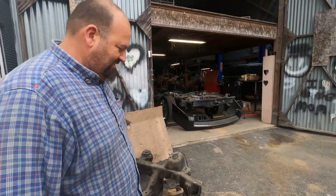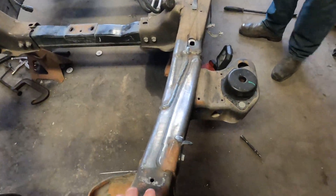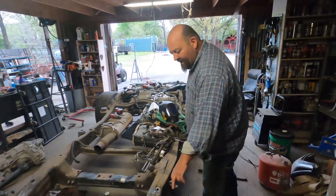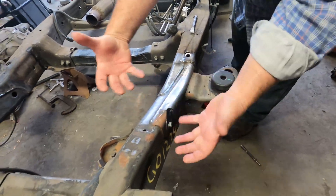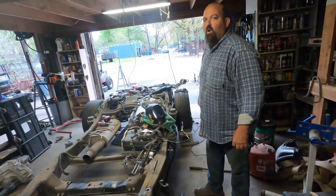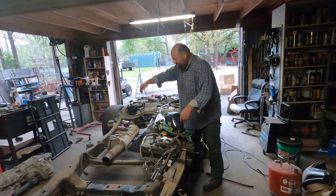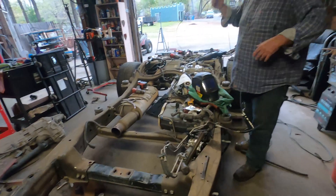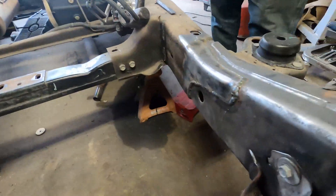So let's go see how frames are assembled and how you fix them. You can see the front section is already on. Before we go into how to do it, we'll explain how it's put together and why you can do it. The frame is actually built in two separate sections. The rails are called hydroformed because all the shaping and rolling of the metal is done with extremely high pressure water at the frame manufacturer. Then they put it in jigs once the main rails are built to properly locate all the cross members, brackets, and pieces. They make it in two pieces — from this section back is one piece.